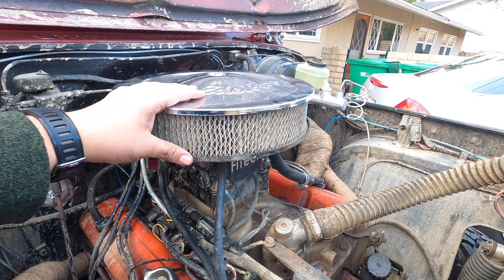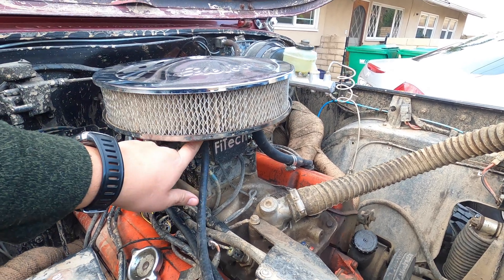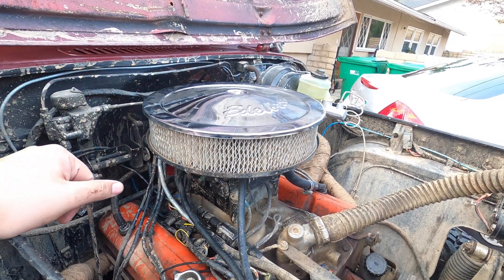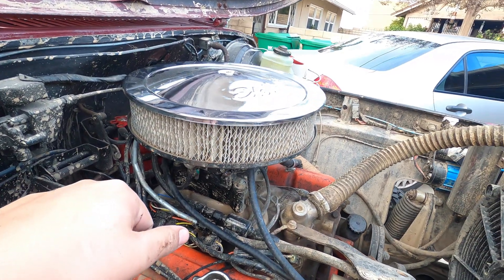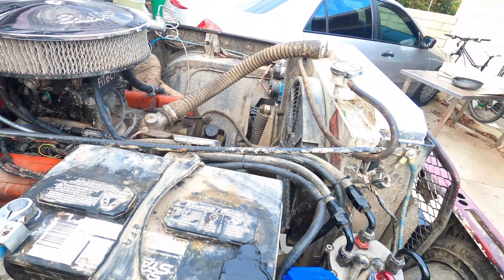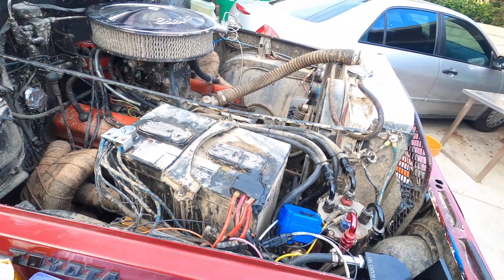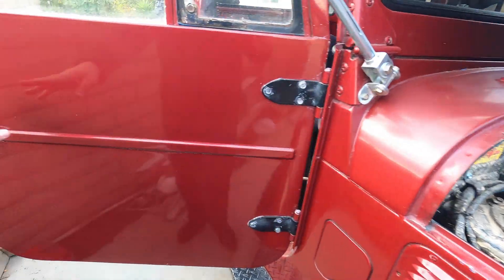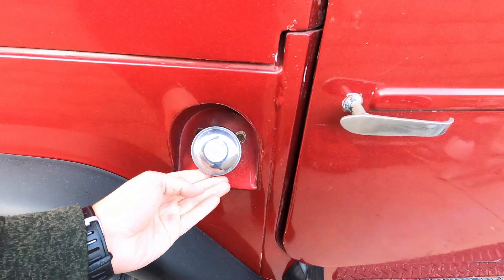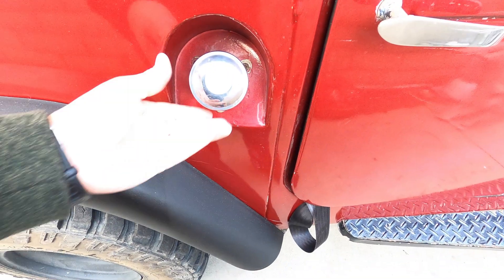Here's the air filter, and inside I have this bung welded in, which essentially vents into that cavity. It's a little on the improvised side of things, but it should resolve the issue of pressure building up through the gas tank and venting through the gas cap.